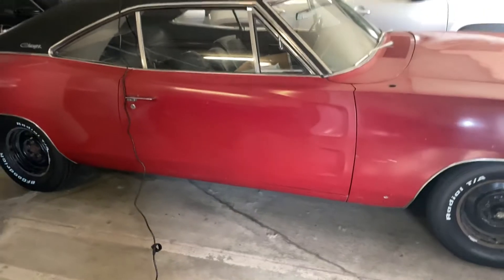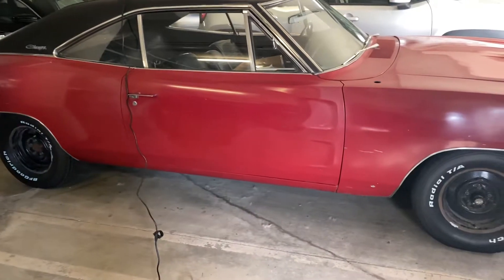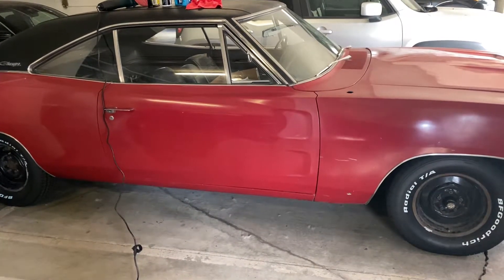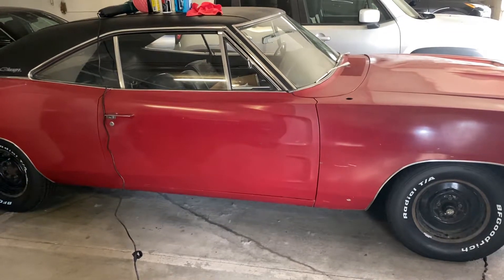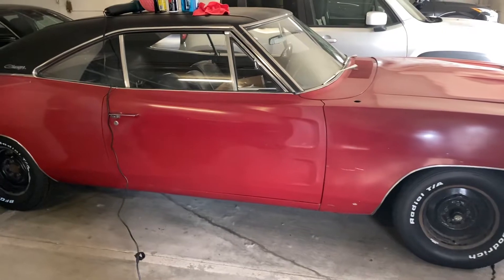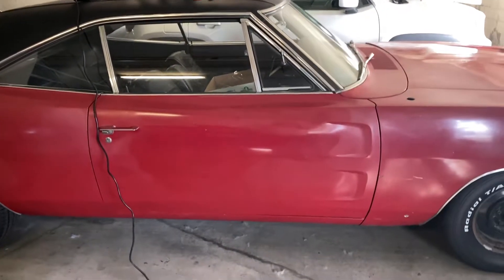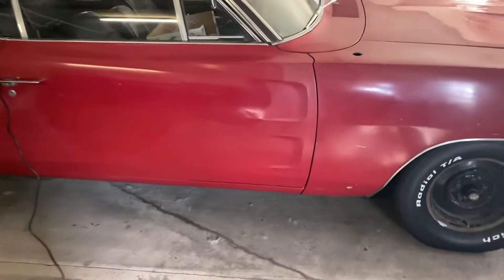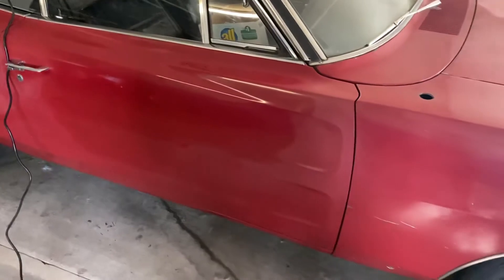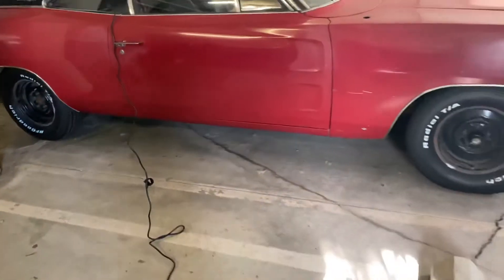That door section had basically a combination of wool cutting pad, finishing that off, then doing some clay bar, trying to get off the clay bar residue with Meguiar's wax, noticing it looked murky and ugly, and then going back with the orange cutting pad again. That might be the ticket.